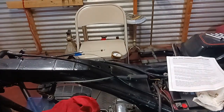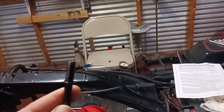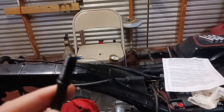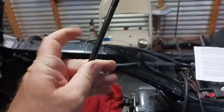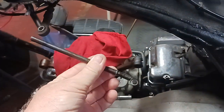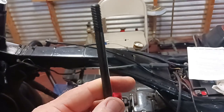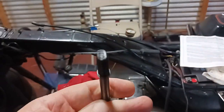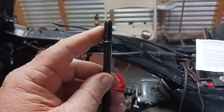There's a guy, Low Country Harley Davidson - I think they call him Doc Harley - go check out his channel. He was talking about this, and also JC - his channel was telling me about it too. You turn those rings down so that little lip is flush, bottom out that ring, then torque it to about 10 foot-pounds. Doc Harley was saying that having it facing up can be one of the causes of a blown head gasket.